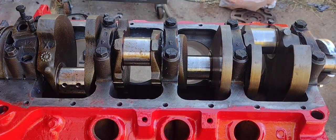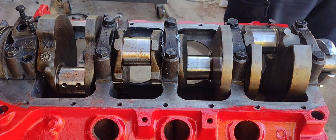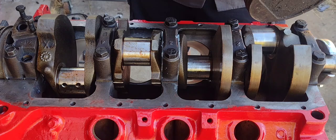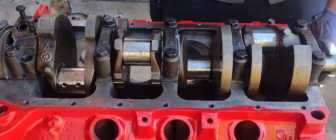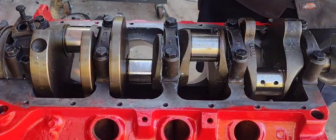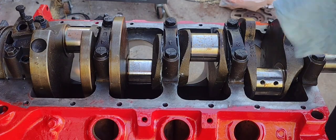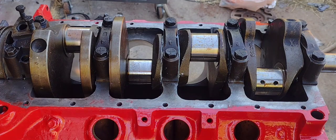It's all torqued down — torqued down with my old Husky to 85, but I put an extra five on it because it's not new. Pistons aren't ready yet; they're all dirty and I've got to clean them up, so we're not going to put them in right now. That's about it — it's in there, turns nice and easy, so we're all done with that. We're going to do that other stuff in a bit. Thanks for watching; I hope you stay tuned to see this thing fire up down the road.